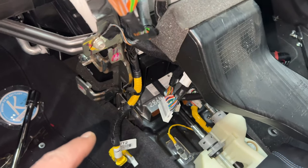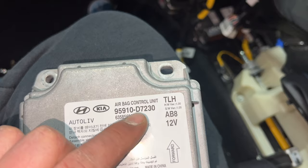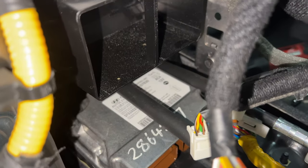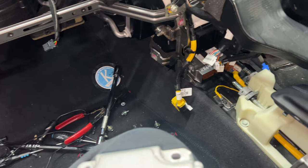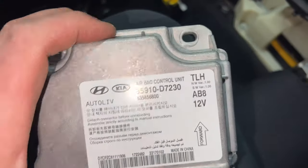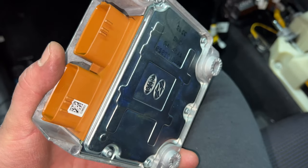After all that pain to swap the SRS module in, I've now found out it's the wrong one. The part number on the end — 7230 on one, 7630 on the other. That one's off a 2020 vehicle; they must have sent the wrong one. The actual pin layout is different, so I'm going to send my original one off to a company on eBay — I think they're about 50 to 60 pounds. They'll reprogram it, and I'll put the replacement on eBay.